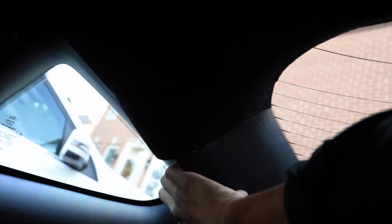You gotta pull down that airbag. Be very careful when you're messing with this pillar right here. They will destroy a lot of things. You're going to pull this guy down. It's gonna be an airbag, so be very careful. And then we ran the yellow wire, as you can see. It's right there. We ran it through there, and then you gotta bring it in, pull down on it, right back up here, because the third brake light is right here in this area somewhere.